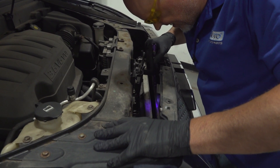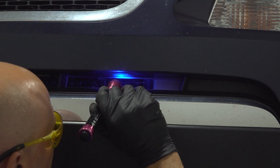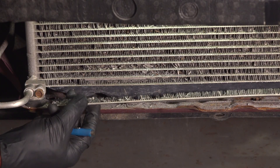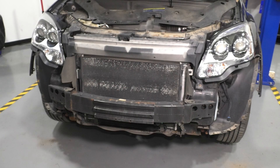If we don't find anything there, next we're going to work from the front of the vehicle and go all the way back. We'll check out the condenser. The condenser takes a lot of hit from the elements. There could be rocks, pebbles, even bugs can get into the condenser and cause a leak. Sometimes the welds on the sides, because of the shaking or movement of the vehicle, can crack. You may have to take a grill off or some components just to see the whole condenser.